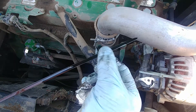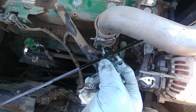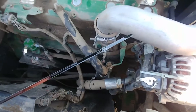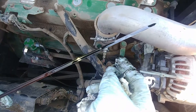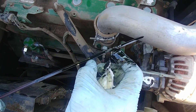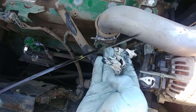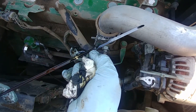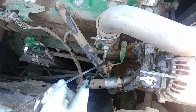The second place where fuel can get inside the engine oil is the shaft seal on a fuel injection pump, but that is most unlikely. As you can see, there's a high mark for the engine oil level on the dipstick and it's almost about an inch over. Let's wipe the bottom of the dipstick — yeah, see how much we are over the top mark, about an inch.